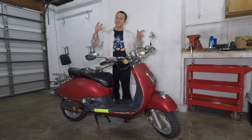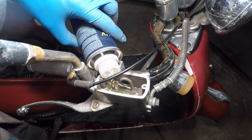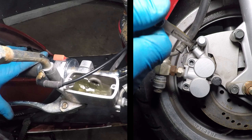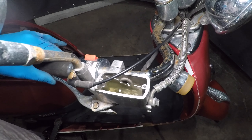That's this piece right here. In the previous video, I inspected this scooter and discovered the front brake doesn't work at all. Two Phillips head screws hold the master cylinder cap and then there's a rubber seal. This thing is completely empty. Where did the brake fluid go? I tried to do a quick brake bleed: open the bleeder, pull the lever, close the bleeder. The brake still doesn't work. I think the piston seals and the master cylinder are bad.